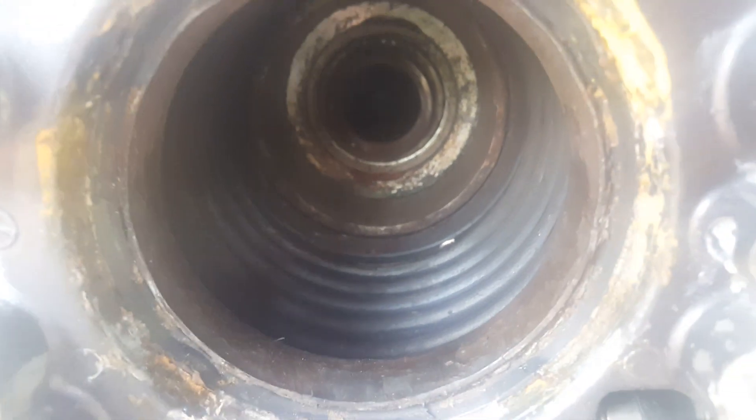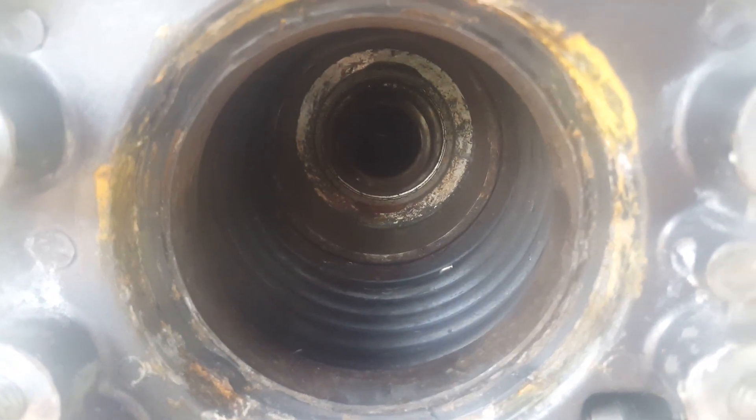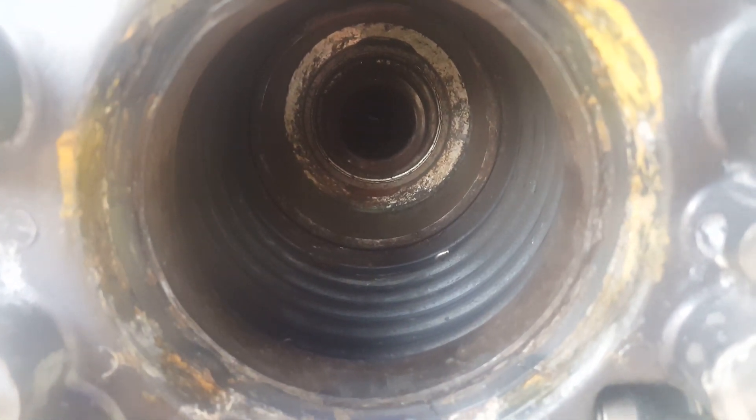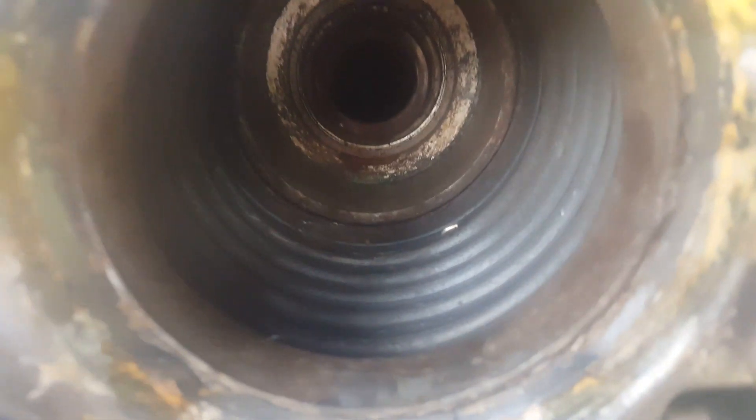Take a look at your bellow in there and make sure you don't see any obvious cracks — if you do, it's a good time to replace it. You also don't want to see any water in there. If you've got a lot of rust — mine is more grease in my case — water and cracks are the warning signs. I'm going to show you a quick trick because it's hard to see inside these valleys and determine if you actually have any cracks.